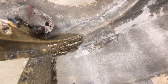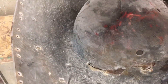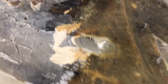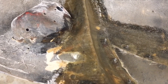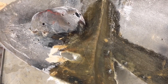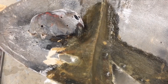We're looking pretty good. Still have quite a bit of fiberglass work to do. As you can see here, I mentioned earlier that the headlight buckets — whoever fiberglassed them in did a terrible job. So I will be sanding that stuff out, refiberglassing the buckets in, getting rid of the bondo that somebody did. The horn grille — I'm going to actually make four mounting brackets onto that. The horn grille will go on the outside, and on the inside will be a three-inch duct for the front disc brake cooler. It will push air into the front discs, keep them cool during any kind of track time.